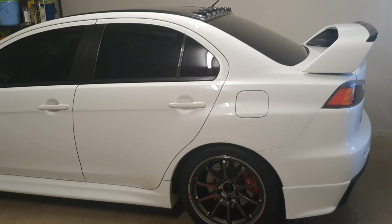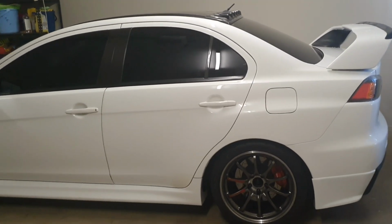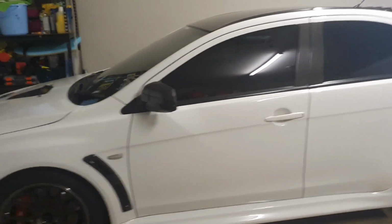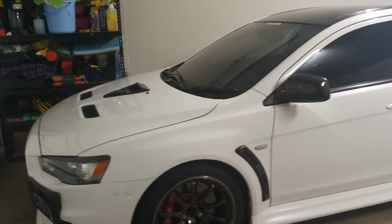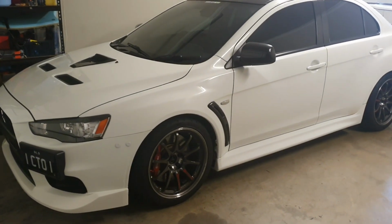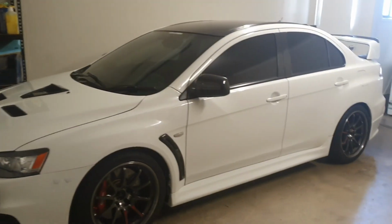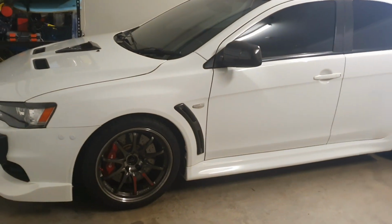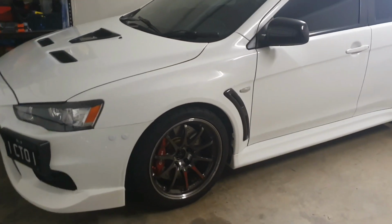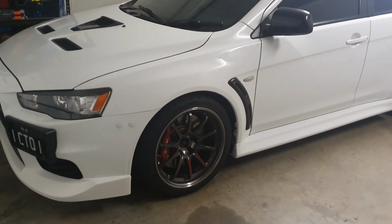So first of all, yes, I'm doing a 2000 grit over most of the panels with light water. I'm not concerned about there being light scratches through the car because I'm later on going to use a compound to get rid of that even further. So you might be asking, why am I actually doing that then if I'm going to use the compound? Well, the reason is because I don't want to actually get the overspray into the pad. So I'd rather just use some time and some elbow grease to very lightly get rid of that overspray.